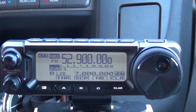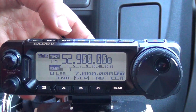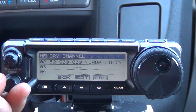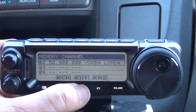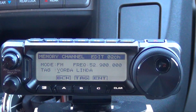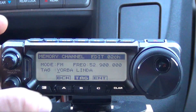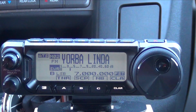To exit back out of this menu, hit the A button. Now to display the tag that you just entered, press either the memory to VFO or VFO to memory button — either one's fine. Rotate the knob to find the channel you want; in this case it's number two. Press the edit button, which is button B, and then press the B button again for tag. Highlight that, then go back out of the menu, and there you go — you're all set.